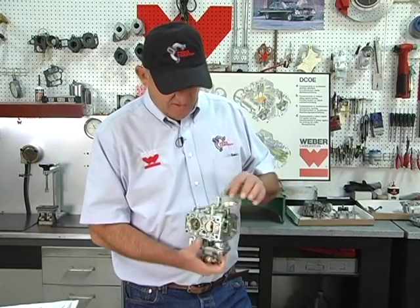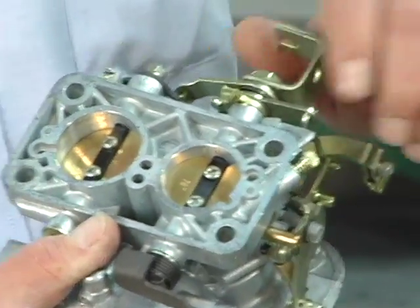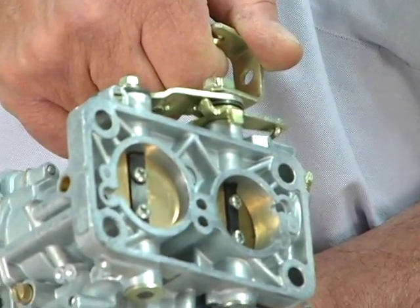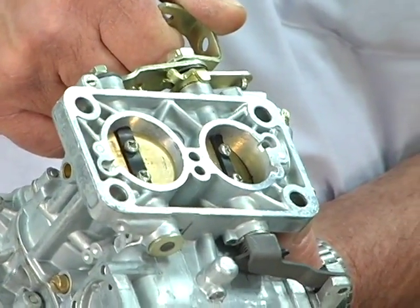You open the throttle and you turn this screw in, and you can turn it in just a hair. I don't know if you'll be able to see this, but when you barely move it, you expose the first progression hole. If you try to idle with the first progression hole exposed, they won't idle down. You let off the gas, and instead of coming back to a crisp idle, they bleed fuel, the idle hangs up, the RPMs drop really slow.